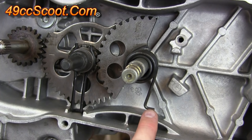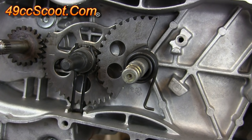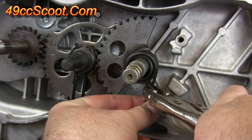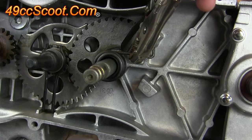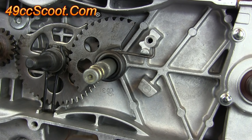Now what I need to do is rotate this section of the spring around this way until it hooks around this section of the case. I use a pair of vice grips to do it — you could use any pliers you'd like, but I find vice grips a bit easier because they stay in place. I lock them on very close to the coil up here so that they're out of the way. Then I'll twist this around and put that hook right behind that section of the case. You may want to push it back a little bit just to be sure it stays there. That has tension on it now so be careful around it. Before you go any further, you may also want to go back and look at your alignment marks and make sure they're still where you had them — if they are way off, you may have to go back and reposition some things and try again.